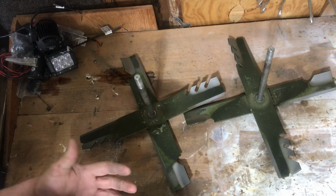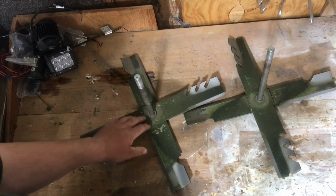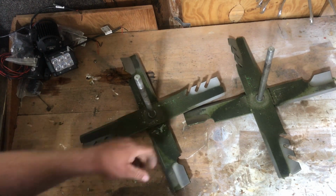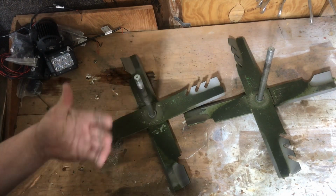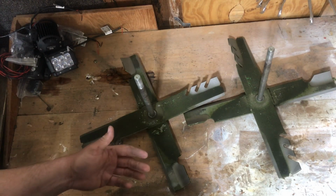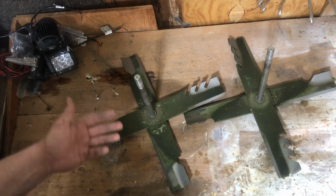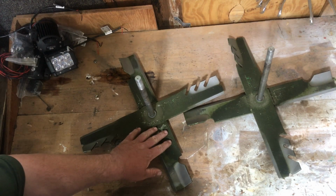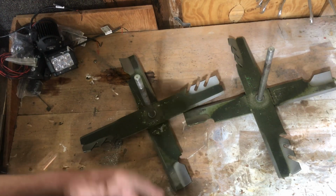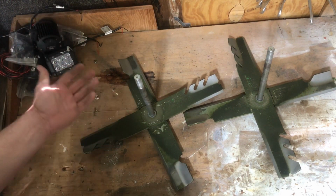I have a weekly account that I do, and I have different types of customers, but for that weekly account, these blades are not useful, because these are people that want to keep their lawn looking nice. They're not just looking to get their grass cut, they keep their lawn looking nice. So I mow their lawn weekly, and there's not a whole lot of growth during that time. I'm only cutting maybe an inch and a half of grass when I go to their property. XBLADES are a complete waste of time. Just one set of blades is more than enough to take care of that. The clippings are small enough that it doesn't matter. It disperses them, it doesn't matter. With XBLADES, you don't need them on that.